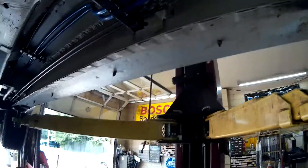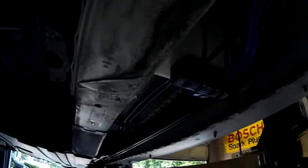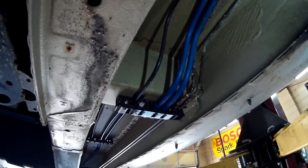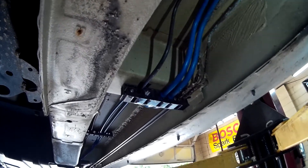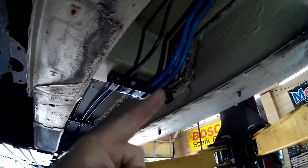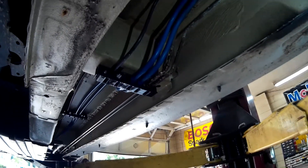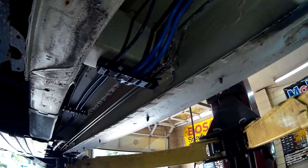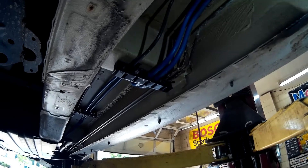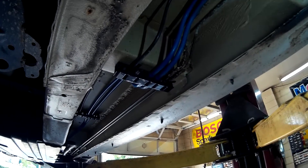I'll be able to come in here, cut these two lines out, and splice them back in after I took all these plastic shields off. If you have a car where the brake pedal feels funky and people keep adding brake fluid for no reason, it's got to have some lines leaking somewhere. Always check the lines, and try to get the full story from the customer — we didn't get the full story on this one.